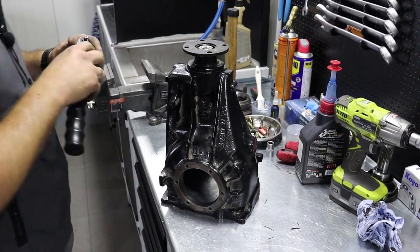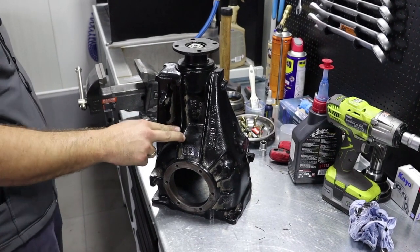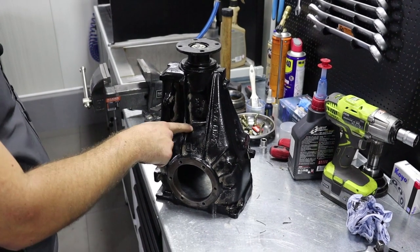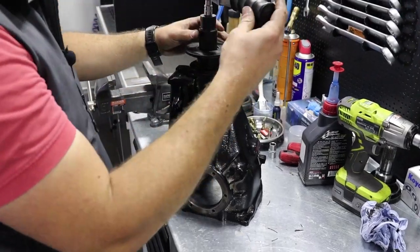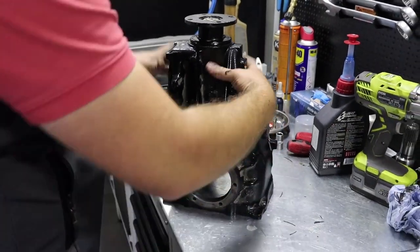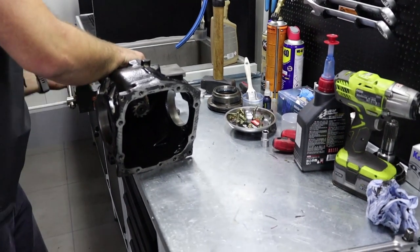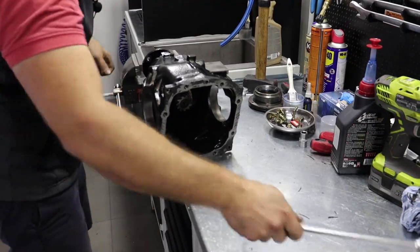This is all done without, as you can see, without carrier unit inside. This is the measure 0.6, between 0.6 and 0.8 newton meters, measured without LSD or any carrier unit inside. This is important. This is 0.2, so I don't know if you could catch this one, but we are trying to keep the video short, so we'll show you at the end.